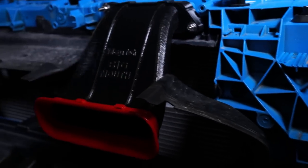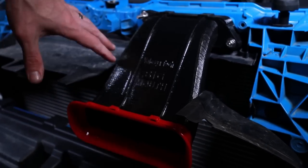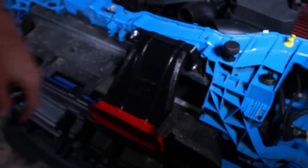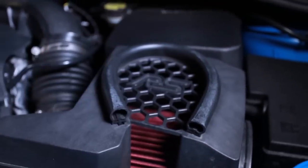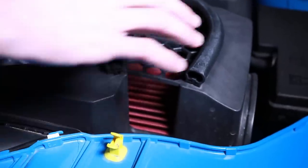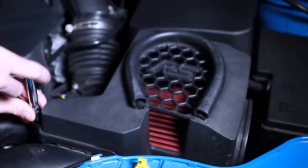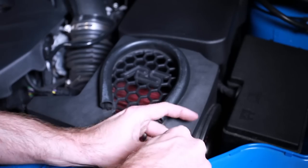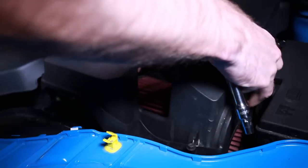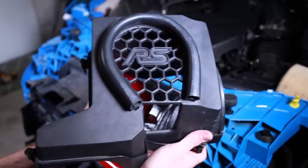The whole trimming process was fairly straightforward — I just used those trimmers and it turned out very good. It looks really cool. The last piece to install is this little Velocitech seal. This basically seals up the air box and makes a nice tight seal so the air box can build up pressure from that ram air effect at the front. I'm just using a 7mm socket to take off the top of the air box, then we'll install this seal and squish it all down in there.